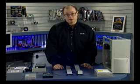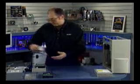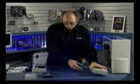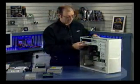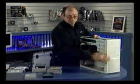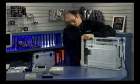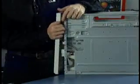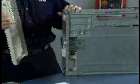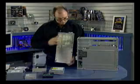At this point, I'm going to physically install the drives in the chassis. Let's move the cables out of the way and get the case ready for the drive installation. To install the drives, we have to remove the front panel from this case. On this one, you basically grab from the bottom and pull and then pry the rest of the assembly out. It's merely pressed on these attachment points. I'm going to set this off to the side.